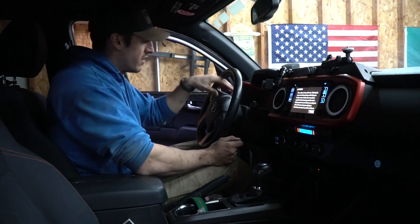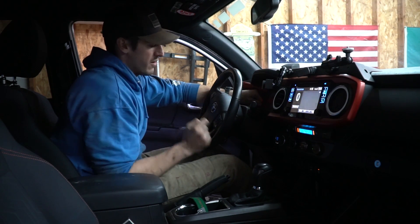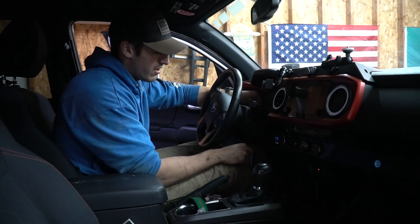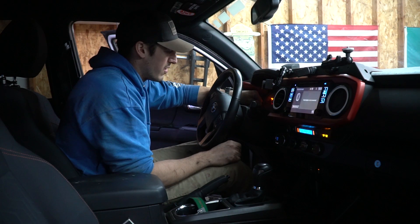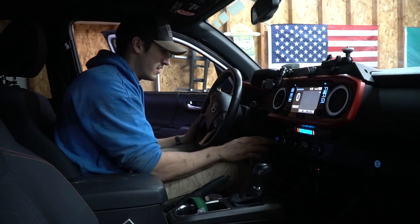There's also a pretty cool way to reset the oil light if you don't have a scanner. Start by double tapping your engine start button to get your dash to come on. Once everything's on, go to Trip A by pressing this button here and press and hold the trip reset button. Turn off your accessories, keep holding. Turn it back on. Continue to hold that button on your dash. Turn it all the way on — you're going to see three or four dots flashing, and they'll go away. Just like that the reminder should be gone — no more check engine light, no more trip light.